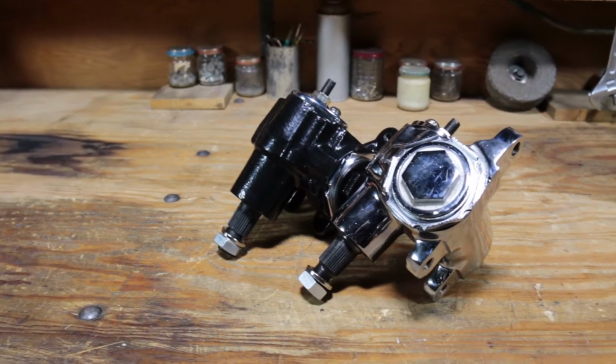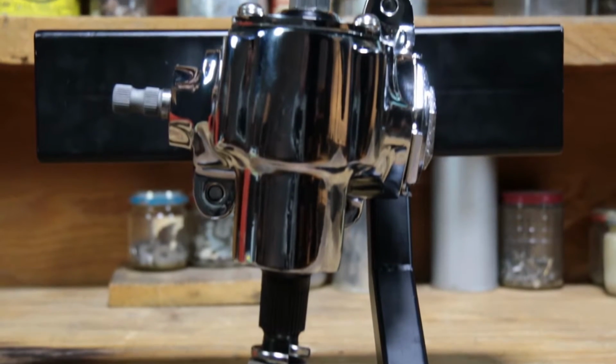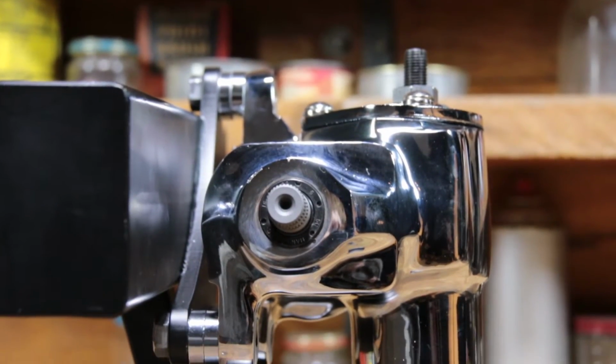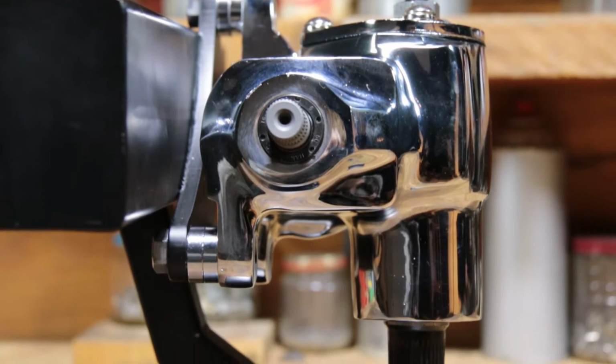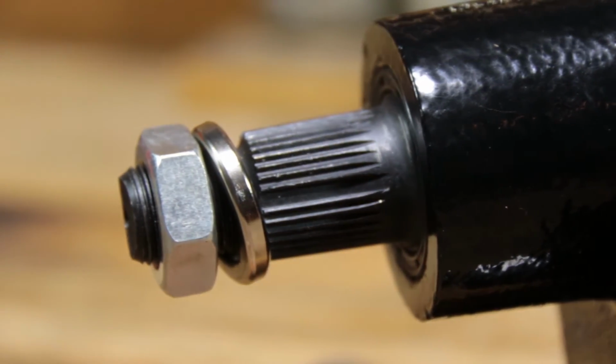The Vega Cross Steering Box is a great start for any hot rodder looking for the foundation of a compact and durable steering system. Designed for use with classic Model T and 1934 through 1948 Ford-style chassis, these steel gearboxes feature 5 turns lock-to-lock with a 20-to-1 ratio.